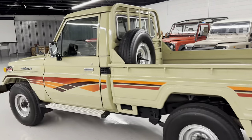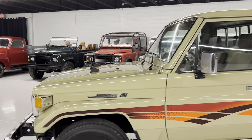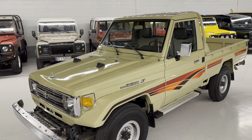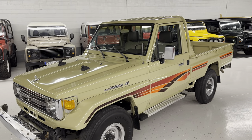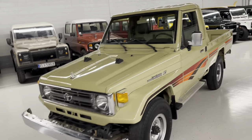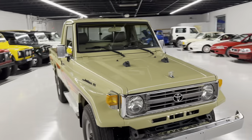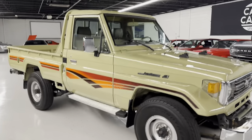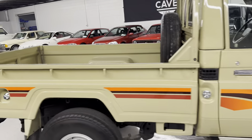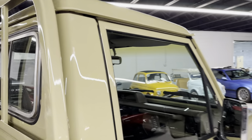It's repainted in a beige. You do have power mirrors that work, power windows that work. We did tear down the wiper system because in the Middle East you don't use your wipers a lot, and it was a little gritty with sand. Since it didn't move much, we actually disassembled the whole thing, tore it apart, lubricated it — got it all moving again. When it first showed up, it would move barely just a little bit with some assistance. We rebuilt all that. There wasn't really parts cost in there, but it took some time.